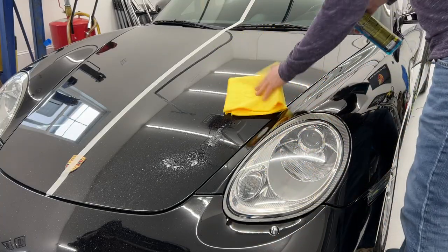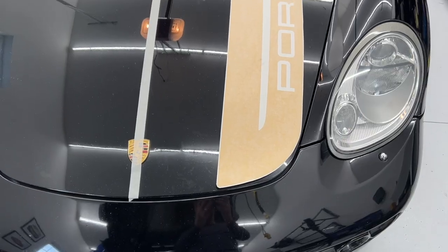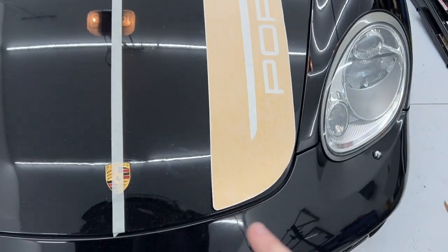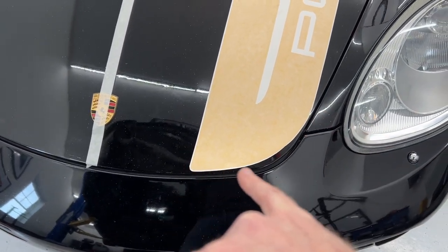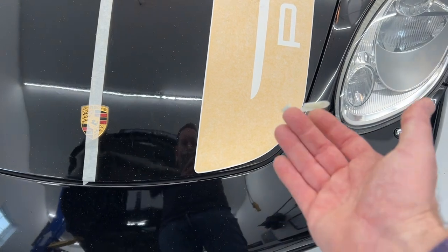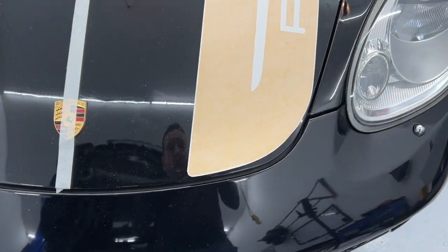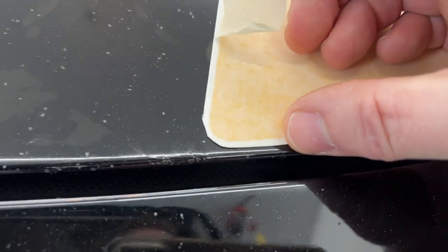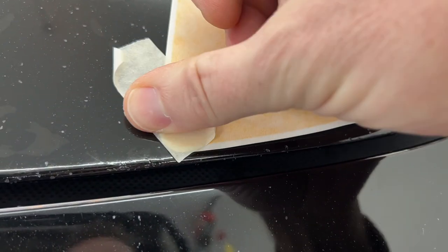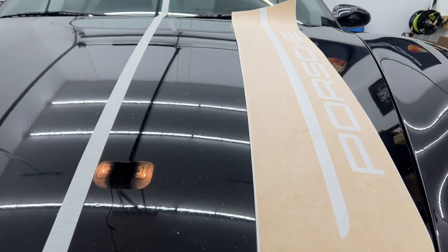I'm going to actually clean the surface of where I'm going to be putting this. So I'm going to start with this one and try to lay it out — I want it to run parallel to our center line. At the end here, it comes down into this crease of the hood, but it doesn't follow it exactly. You could bring it all the way down and have it overlap and go under if you want. I'm going to leave a gap intentionally — that's how they have it in the picture — and just kind of tape it down. Then I'm going to measure from here to here and make sure the distance is the same at the top and bottom.